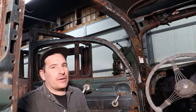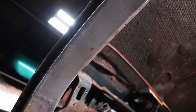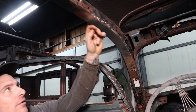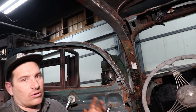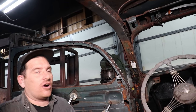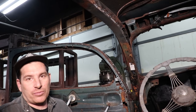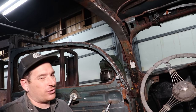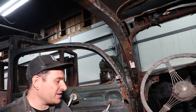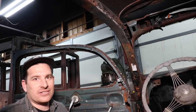Alright, so I got this patch all welded in. I just hit it up with the flap disc to knock the welds down, then hit it with the DA sander to blend everything in, and it looks pretty good. I'm happy with how everything came out, especially with some of the metal being a little thin around here. Everything blended into the corner, and with just a little bit of primer it'll all look as if it never happened. So big progress on the car — we got the last little bit of welding done, we got the floor all coated and sealed up, and basically now we're ready to start putting things back together. I'm going to be getting a wiring harness, we can lay in a rubber floor mat, and we're still looking for some seat covers. Then we can start making this thing look like a car on the inside. Thanks guys for watching — we do videos on Tuesdays, Fridays, and Sundays. Make sure you subscribe.